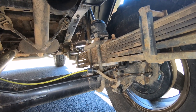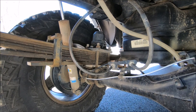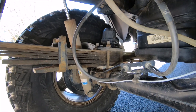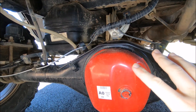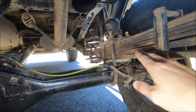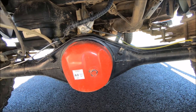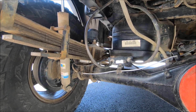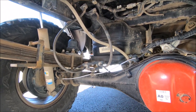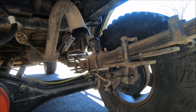Here is the finished product — everything bolted back together. You can see the passenger side axle shim and the driver's side right over there. As I mentioned, the purpose of the shim is to rotate your differential just a little bit so it's in more of a stock alignment. The shim sits on top of your rear axle, and with the U-bolts and everything tied to your leaf packs, the shim rotates those and in turn pulls the differential forward. I took a test drive, and before the install I experienced a very minor vibe at about 10 to 15 miles an hour — right before or right after my automatic shifted into second gear. It completely eliminated my vibes.